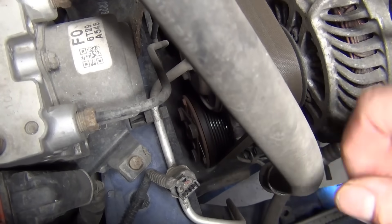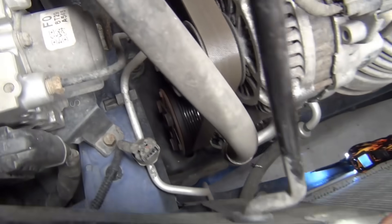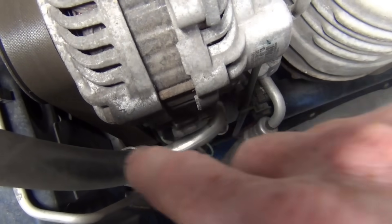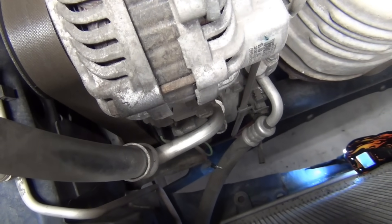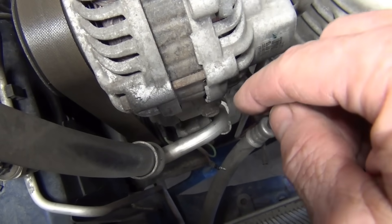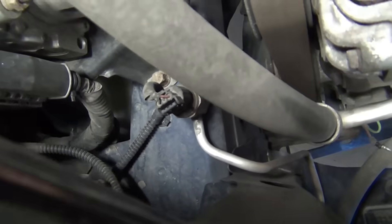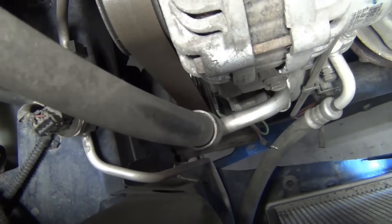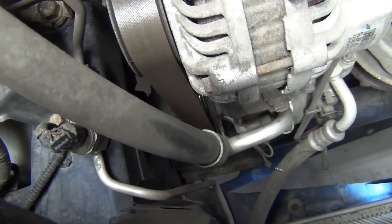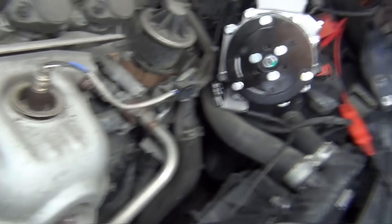You can price these out — compressor clutches are expensive. It costs almost the same amount for the whole AC compressor as it does for just the clutch. So oftentimes what we'll do as mechanics is preemptively fix this by replacing them together and save the customer money. It's awkward when you fix the clutch alone because you pay for all the labor, evacuation, and recharge. It's a lot easier to just pull the whole thing out to replace the clutch since there's a bunch of metal in the way. If you're going to pull the compressor out, it's a good idea to just do the whole compressor. You can unbolt it and tip it out, but it's a huge pain and more labor time for the customer. So I typically just replace the compressor with the clutch if the price is close at all.